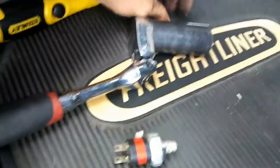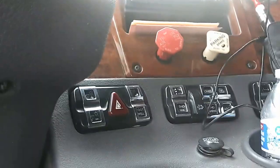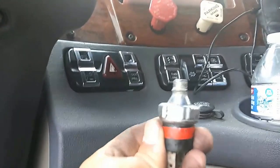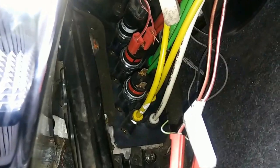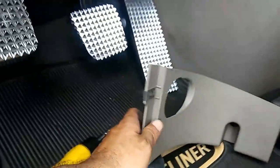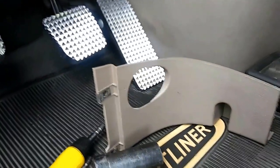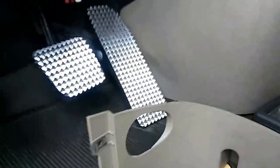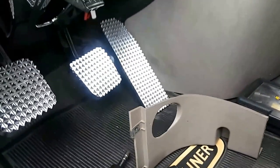People, that's all to it — it's your air switches that control that. If you hear air coming out of there, nine out of ten times it's these switches. Mine are brand new — I just replaced them yesterday. I like to replace them every two years. Remember, it's just this little panel that's got to come off — three screws, this one, this one, and the one in here, and that's it. I hope I was able to help somebody out with this video. Have a good day and we'll see you on the next one.